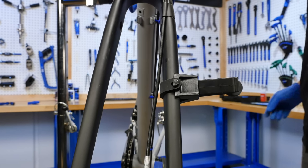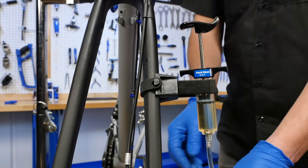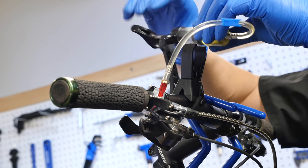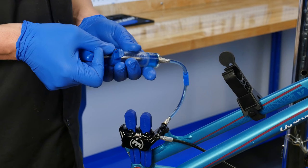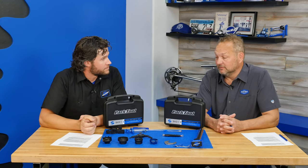A really fun part of the kit is the syringe holder. Bleeding brakes is often a two-syringe process, and when you need to remove one syringe the other is left dangling. So if you're taking the rear syringe off and finishing on the top, you clip this onto the handlebars to hold the upper syringe, remove your lower syringe, finish the caliper bleed, then move up to the lever. We spent a lot of time on these — they are out for sale now.